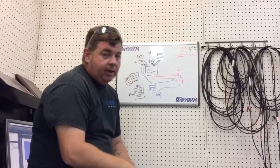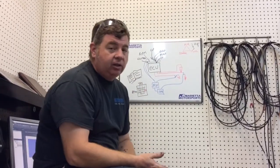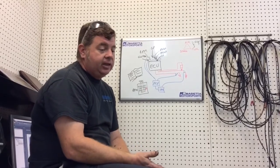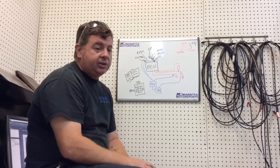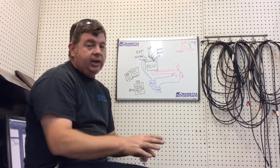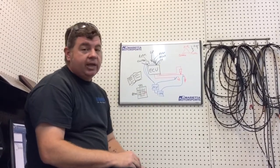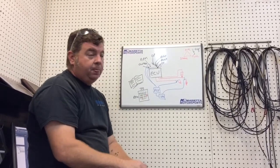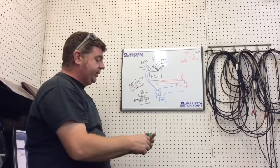The last thing I'm going to talk about is the difference between adding a piggyback fuel controller and flashing. We do a lot of flashing on Yamahas. Kawasakis can get flashed. There's really not a need for GSXRs or Hondas to get flashed because they're not dumbed down. The controllers are good, and what it does is good. The fueling might not be right because you've made changes, but all you have to do is add a piggyback to those. But on Yamahas and Kawasakis, the book is so wrong that it's easier just to change the book.